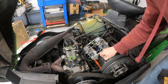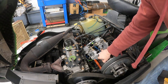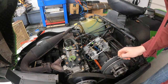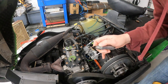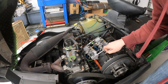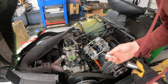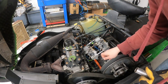There's only one mixture screw on this carb, apparently just for idle to quarter throttle. In addition to the issues with the clutches and belt tension, it was probably running a little rich at the same time — that's definitely a rich plug and I think the screws were a little too far out. The only other adjustment is changing the jets themselves, but I'm not doing that. I'll just clean off these plugs and reinstall them, then check them after I run it.